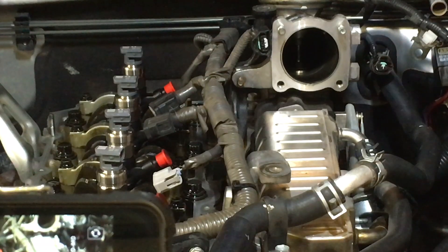Which vehicles need a Pilot Learn? All the older ones, like the 120s, don't need a Pilot Learn — there's no Pilot Learn on those. It's the 150 Prados that need the Pilot Learn, and of course the same vintage Hiluxes. We're talking from approximately September 2009. If you've got a 120 Prado, no. If you've got a 150 Prado, yes — it's as simple as that. Once you put those compensation codes in on a 150 Prado, you're going to get an engine light — panic stations. So be ready for that.